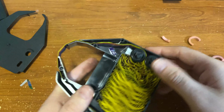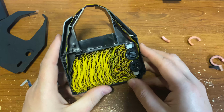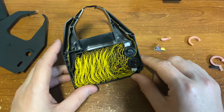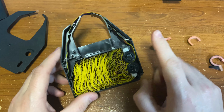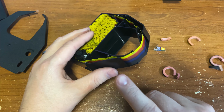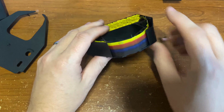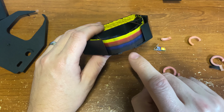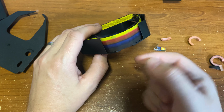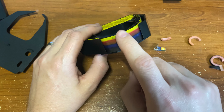Now we're going to tap it down a little bit, and my piece of plastic fell out because the top isn't there, so the ribbon pops up a little bit. Now, I'll put these plastics in, we'll get this button back up, and we will test it on my ImageWriter II. But before we get it all buttoned up, when you have these rollers fail, if it fails in the middle of a print, what you will see generally on the ribbon face here, you start getting holes or you get very thin areas because it's still trying to print. It's still boom, boom, boom, boom. The dot matrix printer is still hitting this ribbon, but because it's not being advanced, we're putting a lot of extra stress on here.